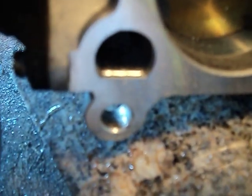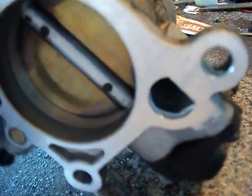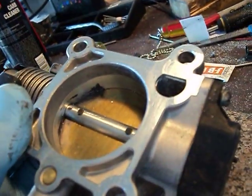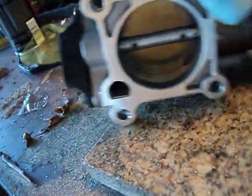What I've done in order to ensure that the JB weld holds much more effectively is I took my bit — you can see that little shiny area — and I just scuffed up and made a little notch on the inside of that, going into the body of the throttle assembly, so that it'll give the JB weld something better to hold on to.